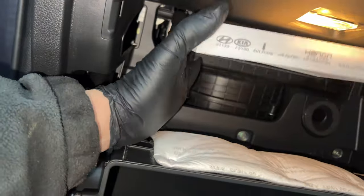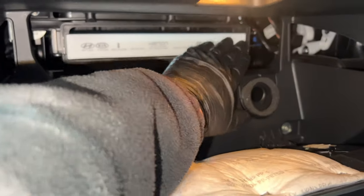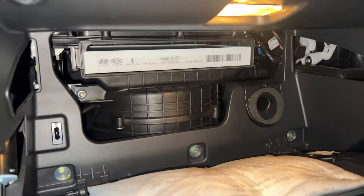The last filter today will be the pollen filter — this area at the top is where it lives. Just squeeze these two bits on the end, it'll come towards you and pull out. Always remember the direction of airflow — as you can see, the arrow is facing downwards. It's easy to put in the wrong way round because it's the same shape. And as you can see, very dirty compared to the brand new one. Fit that now and then put the glove box back together.